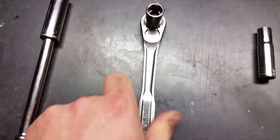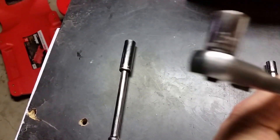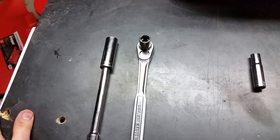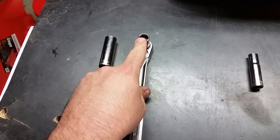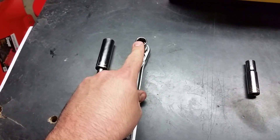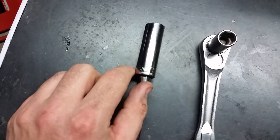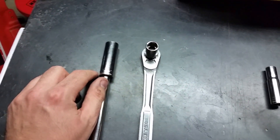Tools you're going to need for the top bolt of the starter: you're going to need a 15-millimeter with an extension and, of course, the ratchet. You're also going to need a 13-millimeter — that's for the top. The first bolt you take off on the top is actually on a stud. Then you'll remove the wire, and then you'll use your 15-millimeter to remove that stud from the starter.